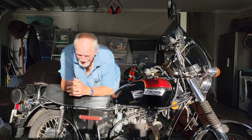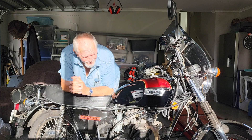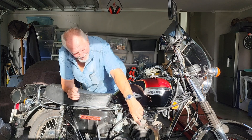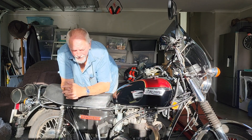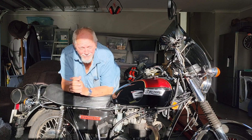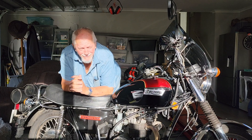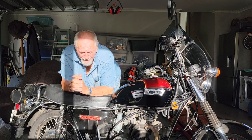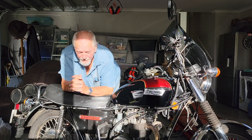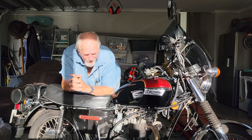The minimum is a little open to question in that the oil pressure light, which normally runs off a pressure switch at the front of the bike, operates at 3.5 PSI. If the oil pressure light comes on at 3.5 PSI it's pretty terminal — especially if you're riding on the motorway and suddenly find you've got 3.5 PSI. They're very unreliable and some don't even operate at 3.5 — aftermarket ones are rubbish.